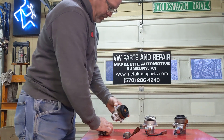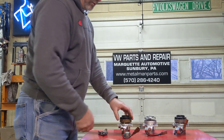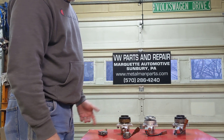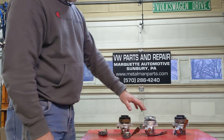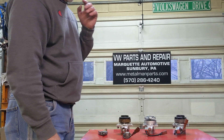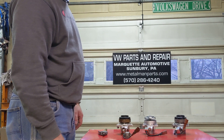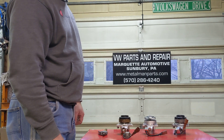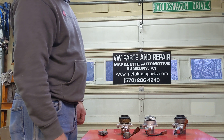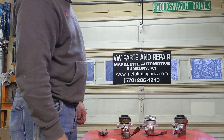I've seen these pumps fail where the collar was blocking off the impeller. They're kind of expensive, so I usually replace it with this pump which does not have the collar. It still has a solenoid valve, so it satisfies the computer — no check engine light. I'm sure it's a little slower for the warm-up, but I doubt there's much difference at all.